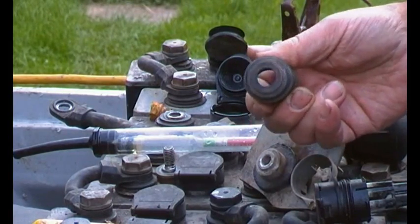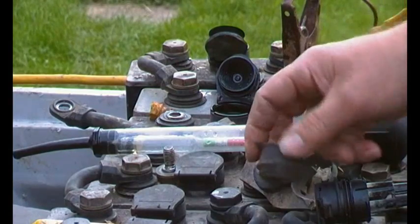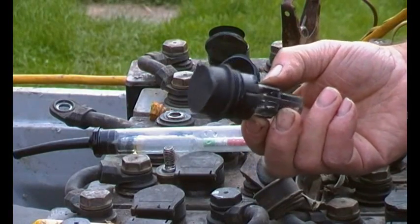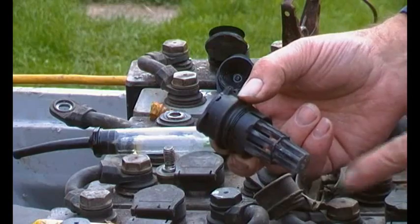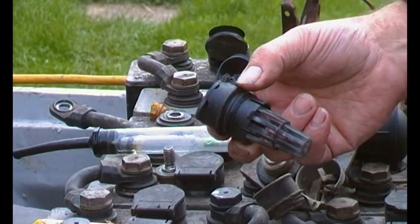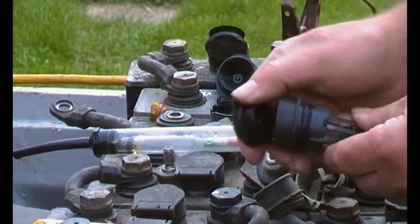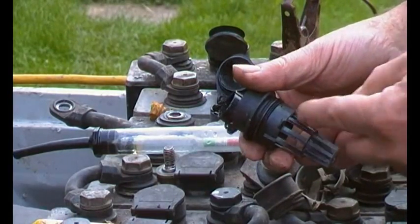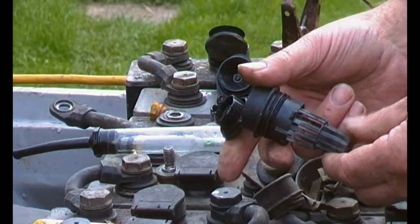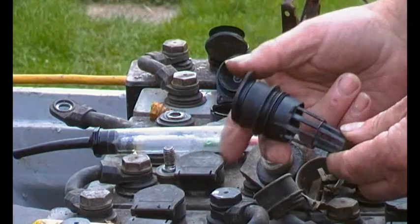So it's important to have the electrolyte at the right level. On some batteries you'll find there's a case, a top, and they have a cage in there. Sometimes there's even a ball in there for automatic float systems. These cages are fine, but you can't see the plates. Some of these push out and others I cut off, just so I can see down there and see the electrolyte level and the plates. This is a guide to where the electrolyte level should be.